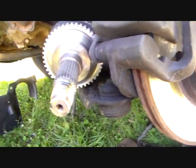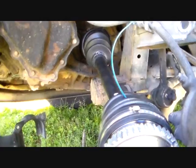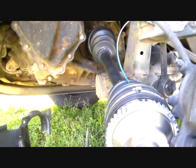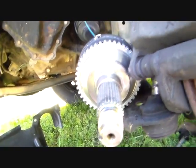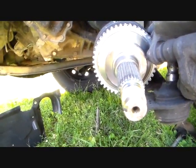I've got 4 different sizes of them, and you wouldn't believe how much usage you get out of those. You just about can't do it. Unless the stars shine on you like no other, you'll never get this out with a screwdriver. So you can either use one of these, or you can use a crowbar, but just be cognizant of where you're prying under here. You have an aluminum transmission case, you don't want to go wailing on it. If you weigh 250 pounds, you don't want to put all that weight in there, because you might crack the transmission and then you're fudged.